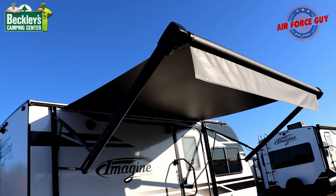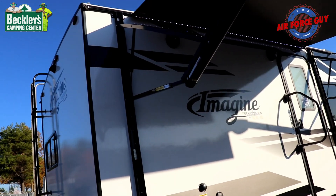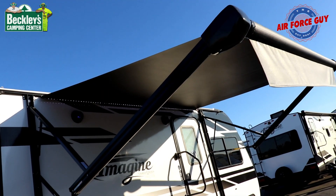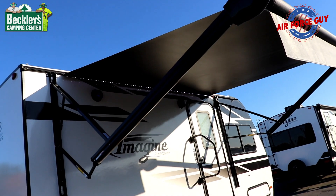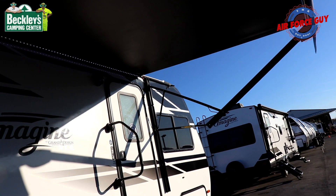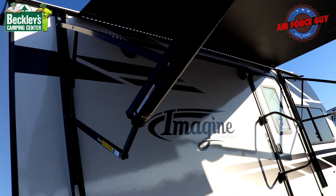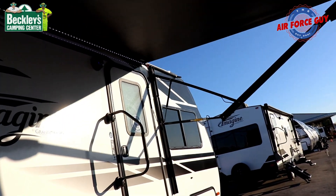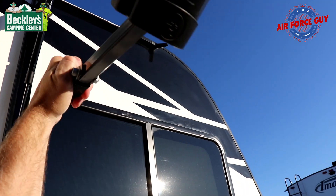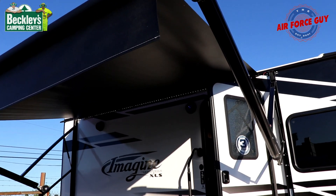On your door side, you're going to notice you have a nice large awning — it's coming out about eight feet from your camper, and it's slanted a little bit. What I like about this type of awning is all I need to do to adjust it is just pull down right here. If I want the rain or water to roll off the backside, that can happen. The beauty of this is I don't have to adjust it when I go to put the awning away — it'll self-adjust. Do not believe people that tell you that you don't need to tilt it. Once water puddles up there, it won't automatically dump because of these struts — you'll be in for a rude awakening. So make sure you dip them a little bit, and also be careful of your door. If you're dipping the front one, make sure that your door is not rubbing on the canopy when you have it tilted.